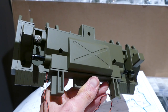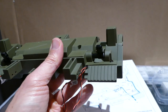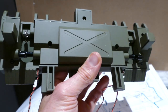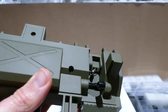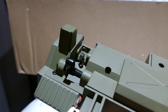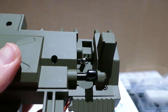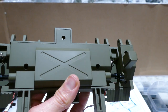Everything is sandwiched together nicely. Just double-check that when you're swinging this plastic piece down onto the back, you don't crease or crimp the wires — there are two exiting on this side, with a little exit hole just there and also one on the other side. Once that's all in, everything should be fine — six screws hold it together and you're good to go. Important note: see these two springs just here — make sure you put them on before you screw this plastic piece on, because it's very difficult to shimmy them in while it's on. Put them on before you screw this down.